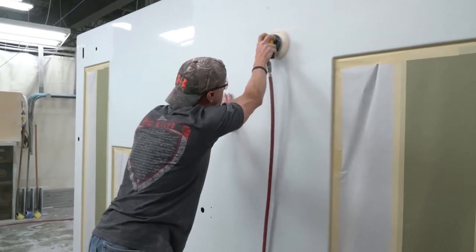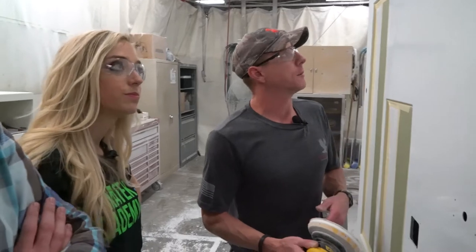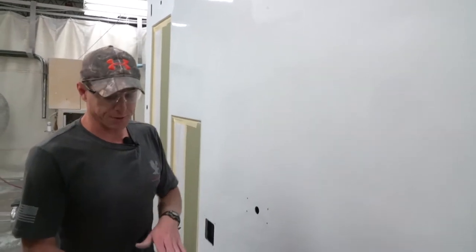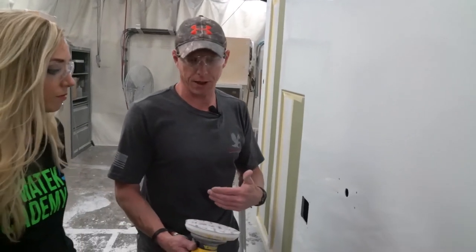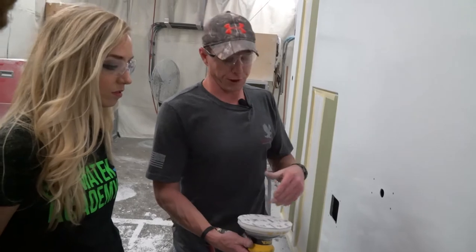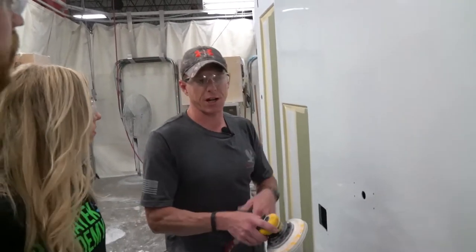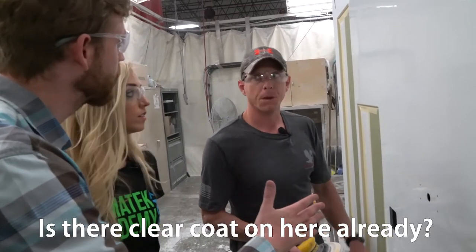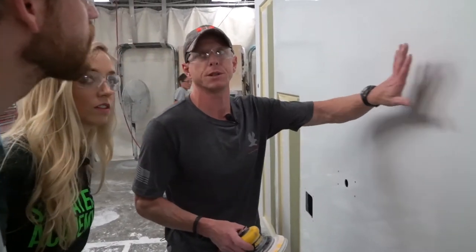Now that the painting is finished, the team moves on to meet Brian, who just started buffing on one of the ambulances. We're going to be sanding and buffing. We use a two-step sanding process here. It's a dry sand process. We use a thousand grit to sand the orange peel out of the module. Then the second step is a finer grit sandpaper that reduces the scratches caused by the first step, refining the sand scratches so that way it'll make the buffing process a little easier. There's already a clear coat on here, and that's where the orange peel comes from.